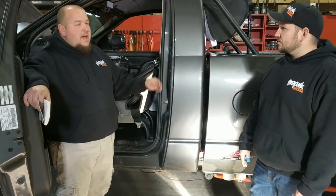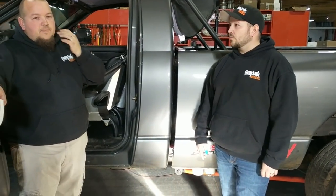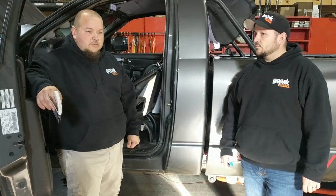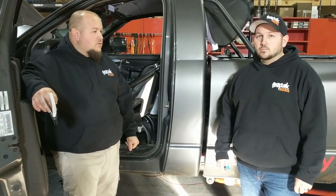Another question is whether you have to have the high bar coming out of the back window. There is a way around that: if you put in a funny car cage that meets SFI requirements, you can get around having the high back brace and keep all your piping below the bed line. So if somebody's really trying to have a discreet street truck, that is an option — it does add quite a number of bars inside the cab, but it's all covered in the NHRA rule book.